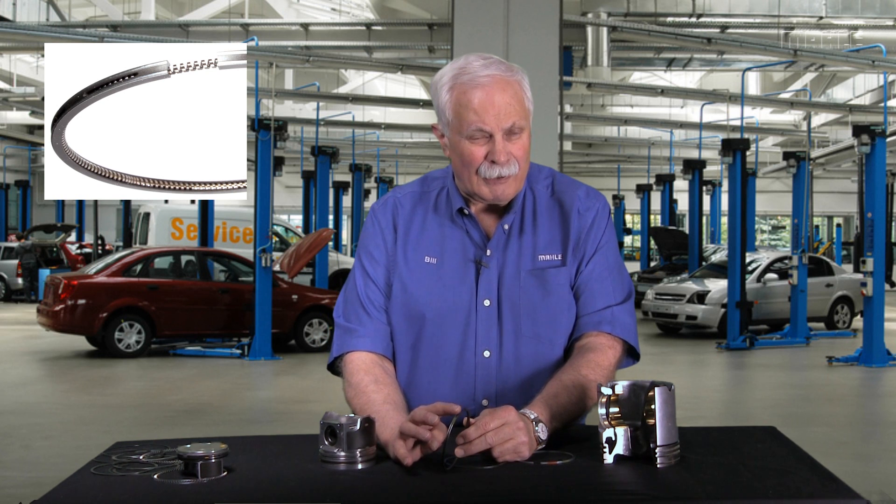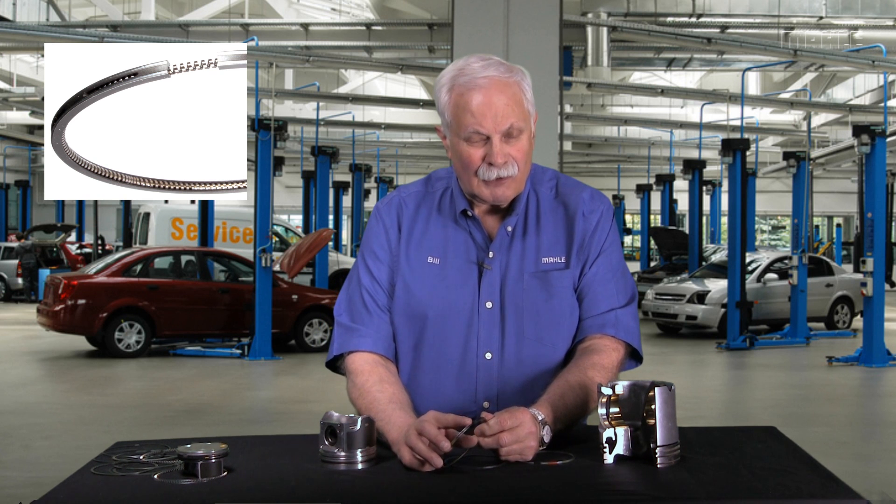I might remind you: when I'm talking diesel engines, I'm talking engines that we expect to run from 500,000 to a million miles before they wear out. So we tend to spend a little more on the ring pack because we're expecting much longer life. The number one difference is in the oil ring. The light-duty oil ring was a three-piece design. This is what we call a two-piece design — either steel or cast iron formed in one piece with slots in it. Behind that we have a coiled spring expander, and it's actually that coiled spring expander that puts the tension out on the cylinder wall for this ring to seal and scrape oil. It's an excellent design but somewhat more expensive than the three-piece design, hence it's used primarily for these diesel engines.